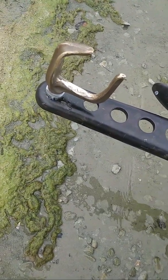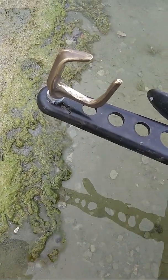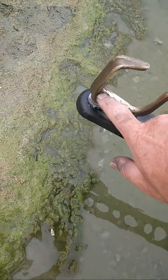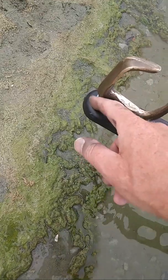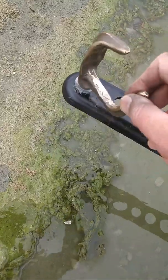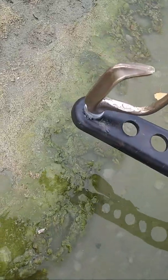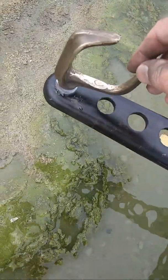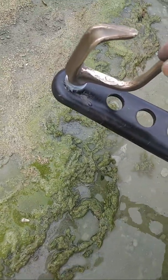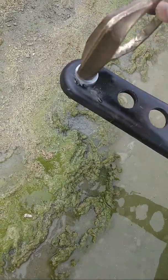And so I've deduced that when I was putting a heavy coat of grease on the oar sleeves, I was using Vaseline, putting it on very thick, and when it was heating up, it liquefies, and it was running down the oarlock into the bushing along the shaft there. And so then that started squeaking, which led me to believe I needed more lube down there. So I started pulling the oarlocks out and greasing the shafts, and that just made it worse. So bottom line is, I'm going to follow Karen's advice and not grease the shafts.